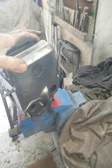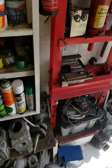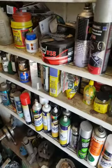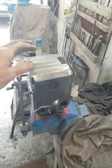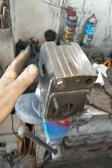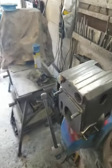I'm going to give it some primer. I'm using a special primer which goes in and neutralizes the rust. It's called etch primer and it's slightly acidic, which neutralizes any tiny bits of iron oxide before you put the paint on.